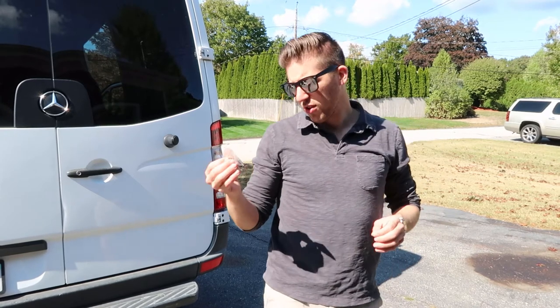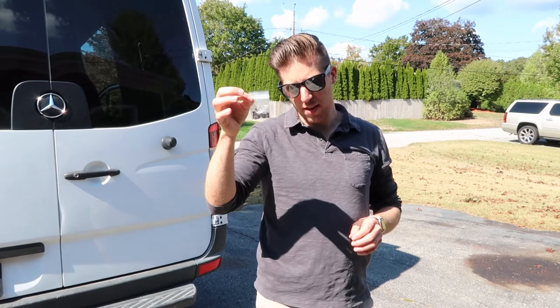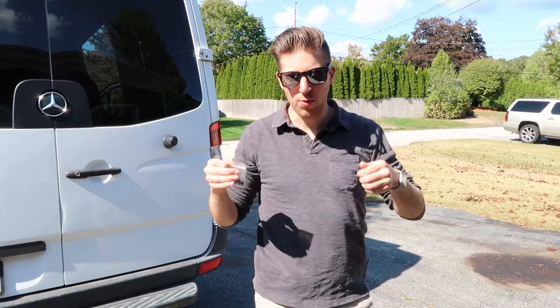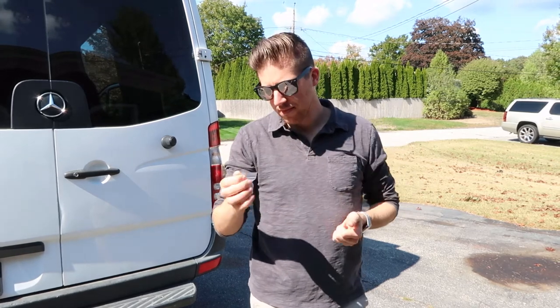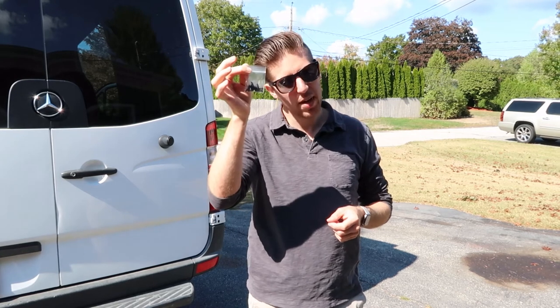So a little trouble we encountered with the last window is they provide these screws, but they really don't have enough bite to grab the casing and into the window and to create a good seal in the van. So what we're gonna do, like we did in the last window, swap these out for some hex head screws.